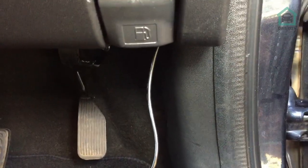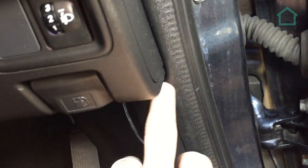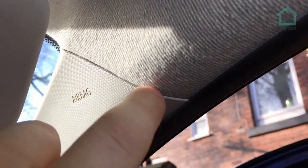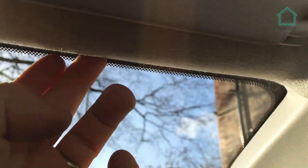Now we've fed the wire through and it's poking out at the top. It's time to run the wire up to the top of the vehicle. We're going to come across underneath this door seal and then go up the A-pillar, tucking in behind the seal all the way up to the top - making sure it's not interfering with the airbag - and then tuck it in underneath the roof line all the way across to above the rear-view mirror. Let's start running that wire.